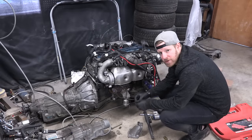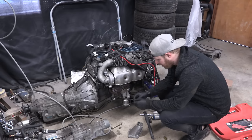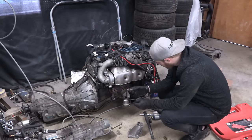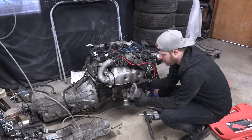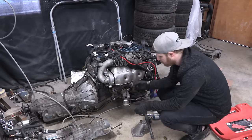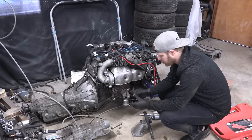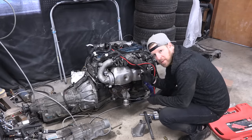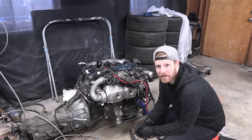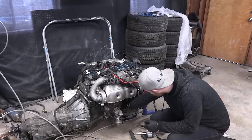Outside of being very confused, I've run into the first major roadblock: the stock engine mounting hardware - these bolts right here. This kit comes with no hardware either, so it's confusing. These bolts don't work because the stock engine mount is much thicker than the new mounting plate, so these bolts are basically too long. Once you have a thinner mounting plate, these bolts max out inside the engine block and can't screw down the plate. I'm going to run around to the hardware stores and see if I can find some shorter versions, and if I can't, I'll buy duplicates and trim them. I've got a new bag of hardware and I'm ready to finish up this mounting plate.